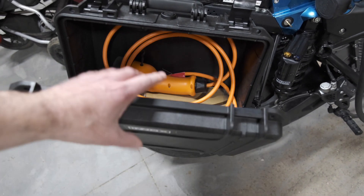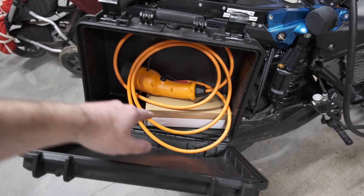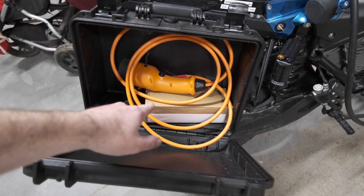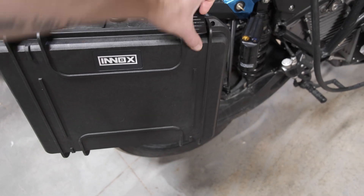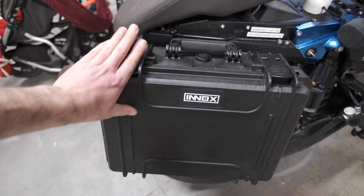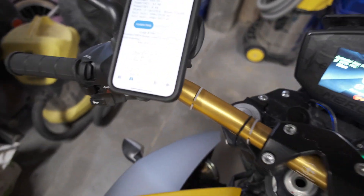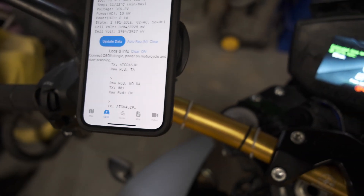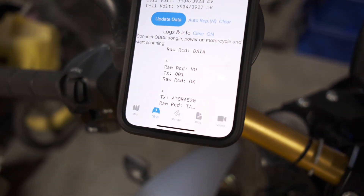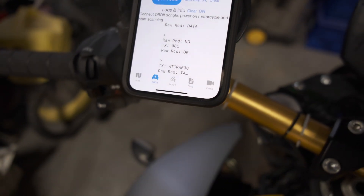That's my fix-everything solution. That adapter is limited to 16 amps, which is barely three kilowatts — which is the limit of this part when charging on AC. The scan is at 529 already. I think it pulls every four seconds or so, so do the math for 800 positions at four seconds — let me know in the comments.